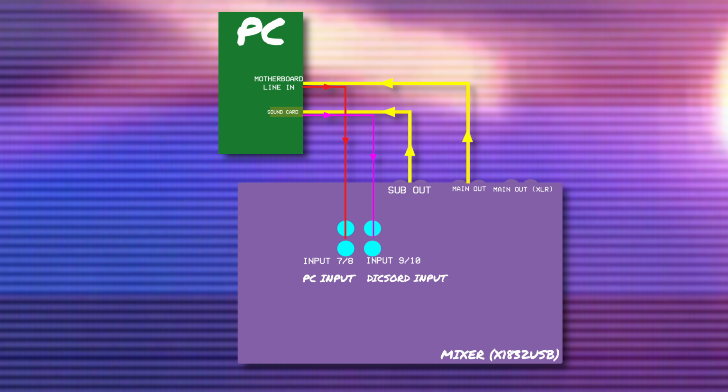The main PC out handles all of my PC's default sounds, desktop use, games, videos, etc. The second output from the PC has VoIP apps manually assigned. This way I can balance my game sound and chat sound, for example, a lot better, and keep them separated in OBS since they are now running to two physically different devices without the need for a virtual audio cable, Voicemeeter, etc. This has been very handy.